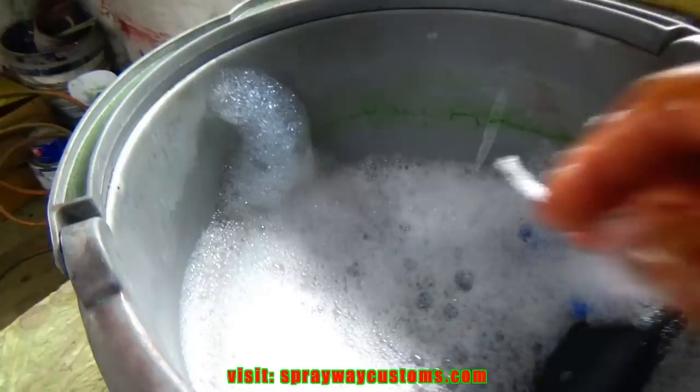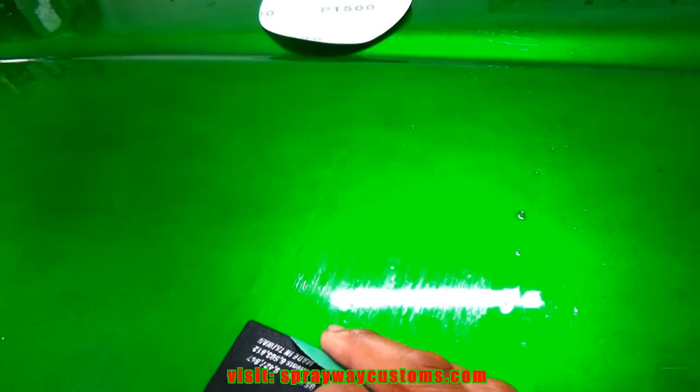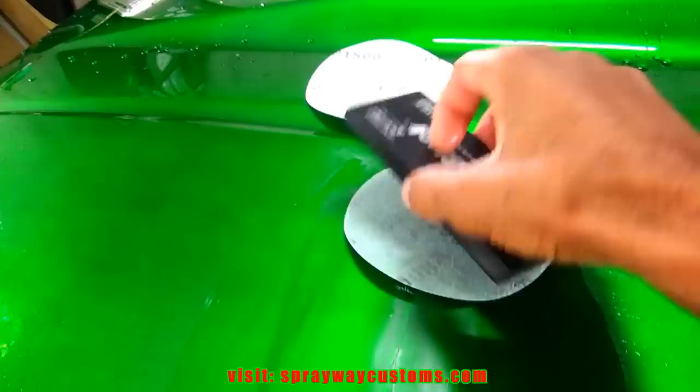So let me put some 1,500 in here. Also put a sheet of 2,000 and a sheet of 3,000. We'll let that soak for a second or two. I got the 1,500 on my block. We're just gonna go maybe a couple of strokes. I think we're going to leave it at that. Then we're going to grab some 2,000, do it right here, and so on with 3,000. Then we're going to see how that turn out.